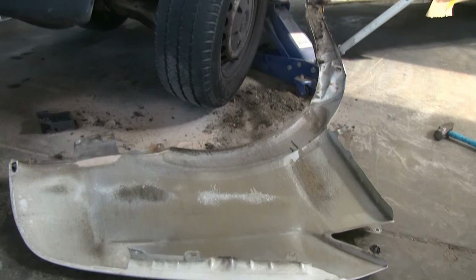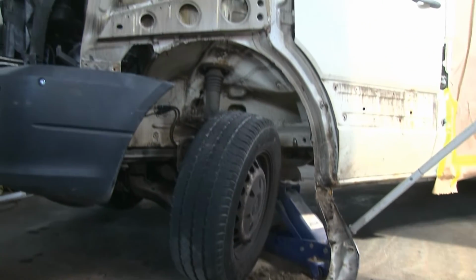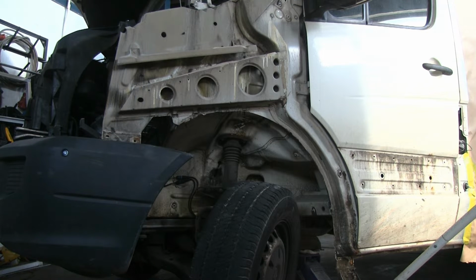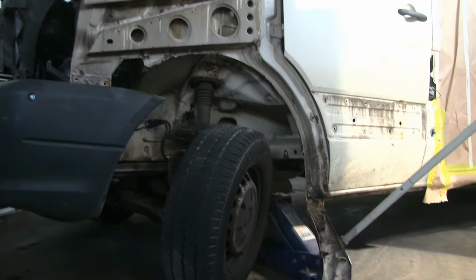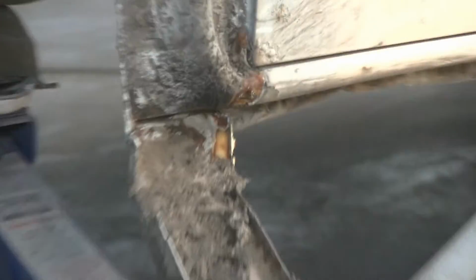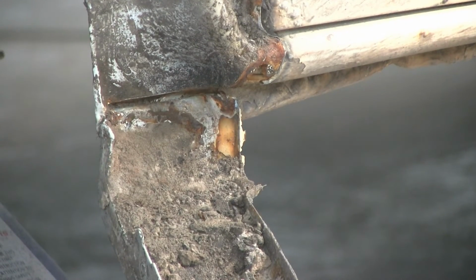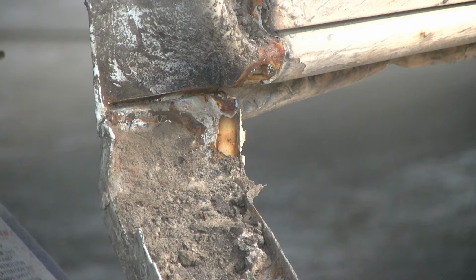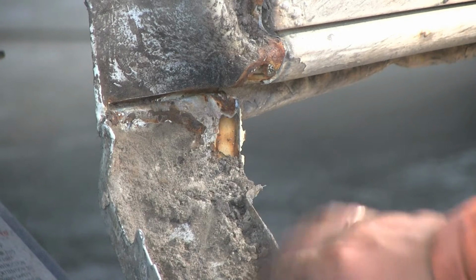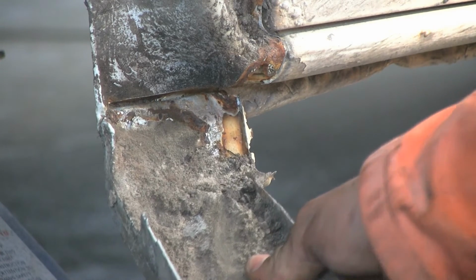As you can see, the wing is already on the floor, and when it opens up, you can see a little better. All behind the wing is just primed, and there are no other coatings on it, so it's fairly thin. Again, if I zoom in, you will see a little better how badly designed it is and how much of an effect it has on the rusty surfaces, because of the moisture trapped by all of this dirt sitting in that pocket. And there is no way out of it. All you needed to do is have a hole in that wall, and you would have all the problems eliminated, with the water just running out.